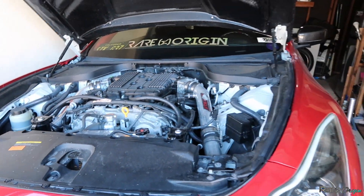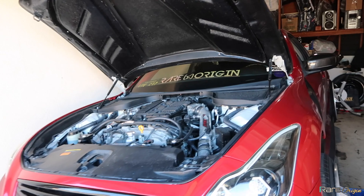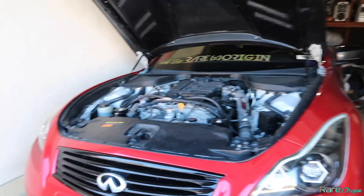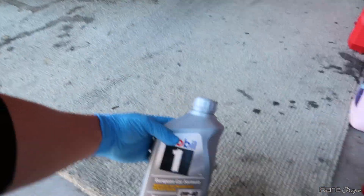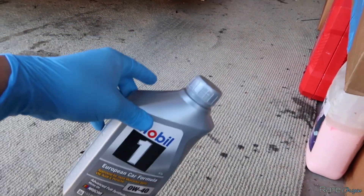Hopefully we are doing better. I also ordered parts for the G35 coupe, and I'm going to order some parts for the G37 coupe too — hopefully I can keep bringing more videos to you guys. So right now we're going to do the oil change on the G37. I use the 0w40 because I have a low mileage engine.